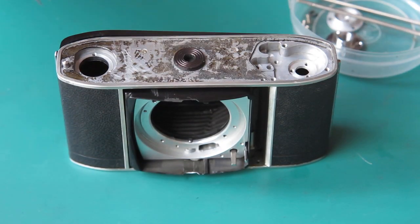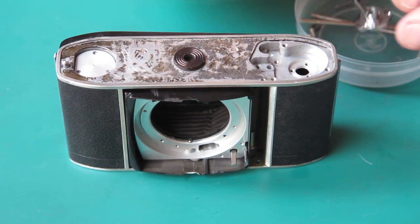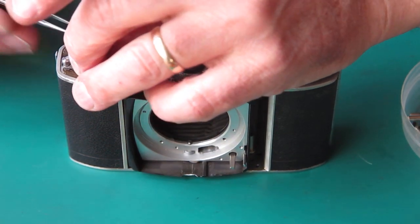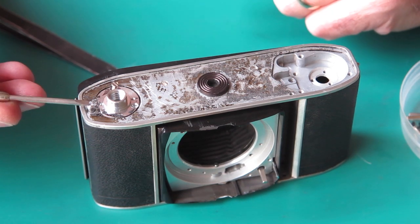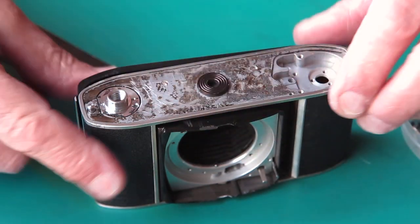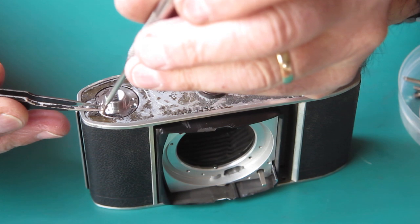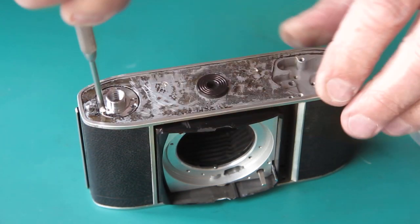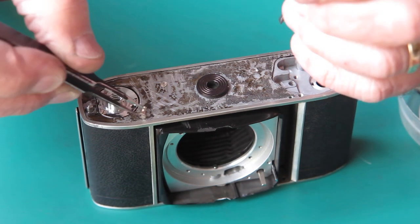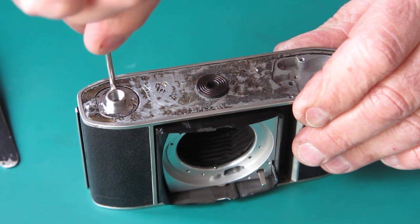At the base of the camera I want to put the little aluminium piece that the film cassette sits into, and the tripod socket. I'll get them in place because otherwise every time you put the camera down on the bench you strike the button here and release the back catch and the back is forever flapping open. These are longer screws - not the longest. The longest ones go in the film advance lever. These are somewhat intermediate. Once all three are in place they can be tightened up.